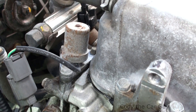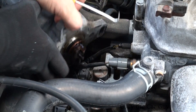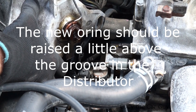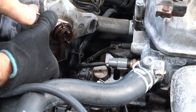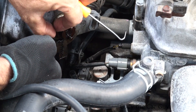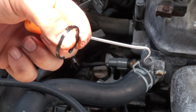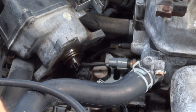It's literally three 10-millimeter bolts, but right now let's go ahead and get a new O-ring on the distributor. One of the things I noticed right off the bat — there's nothing sticking outside of the ledges of the metal right there, and the O-ring is just as hard as it comes. They're literally just broken in half, so there's nothing left of it at that point — time to put a new one in there.